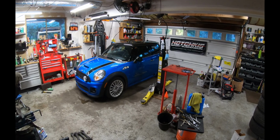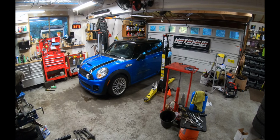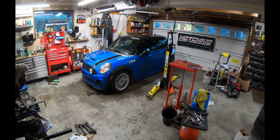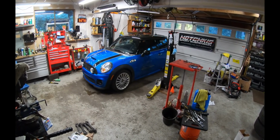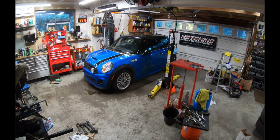Hi everybody. Today I'm working on a 2007 Mini Cooper S. Today I'll be replacing the clutch. You know you need to replace the clutch if it starts slipping, especially in higher gears going uphill at lower RPMs. I'll put a link in the description where you can get the parts.